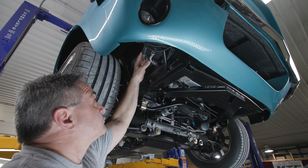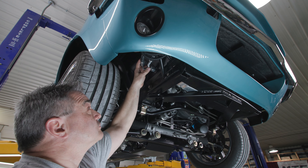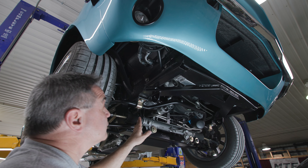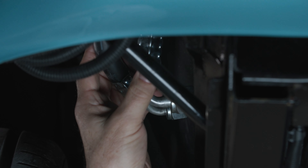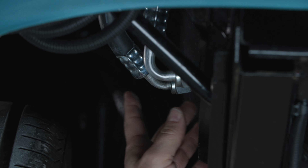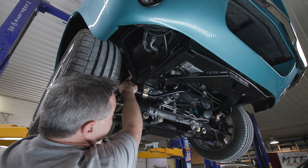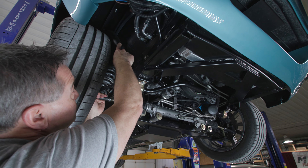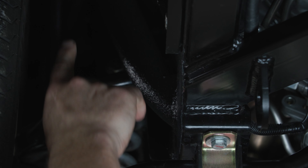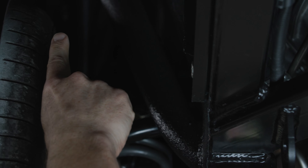This particular car has our air conditioning system in it — the full air system. In order to keep the engine bay as clean as possible, we route the AC lines outside of the engine bay. Carl had decided to use our frame stiffener, and in this particular application we actually use it to tie the AC lines to.